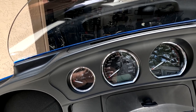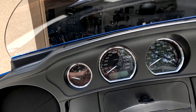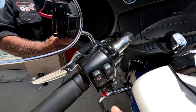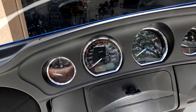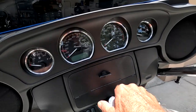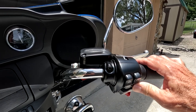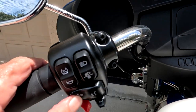If you ever lose your key fob and you're out in the middle of nowhere, or your key fob battery goes dead, you've got to have a pin number. We're going to be using the ignition switch, the kill switch, and the left and right turn signals. Make sure before you turn the motorcycle on that the kill switch is in the off position. Turn the ignition to on, then cycle the kill switch one, two, three, four, five times — and then quickly hit the left signal two times.